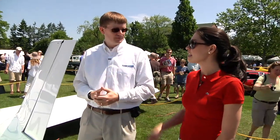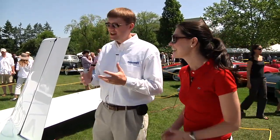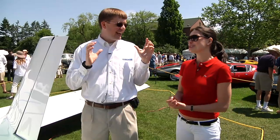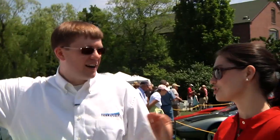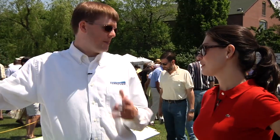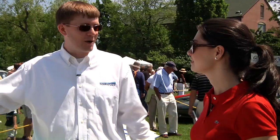On the ground it's front-wheel drive. The propeller is not locked on this one because locking it in place reduces fuel efficiency by creating more drag. On the road you'll actually do better than 30 miles to the gallon. It's a very lightweight vehicle with a 100-horsepower engine. With 20 gallons, you're talking 25 to 30 miles to the gallon depending on how fast you want to fly. It's a small engine, but it's plenty of power for such a lightweight aircraft.